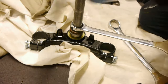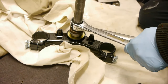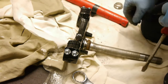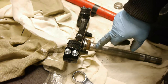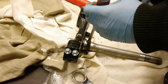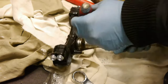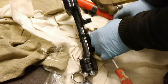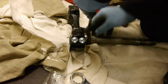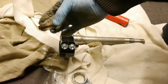You need to use some extra spacers as the pipe gets a little tight inside there. I ended up using the 30mm spanner as the lower spacer, as the 27-28mm is just a little too tight — you can see with the marks there. Once we have that hammered the full way down, this one's still a little tight. So get a large screwdriver, run it in the little slot, tap it in and spread the old race out. It'll simply slide off. Spread it out a little more. There we have it — another simple tip: if you don't have the special tools, there's always a way.